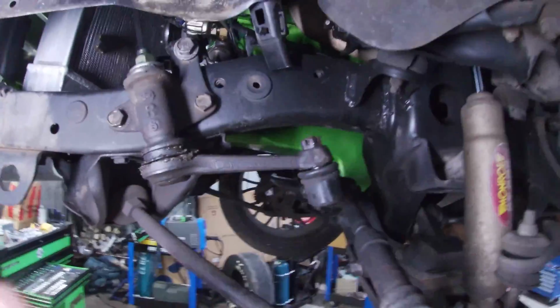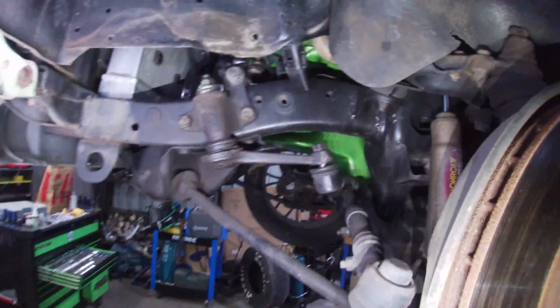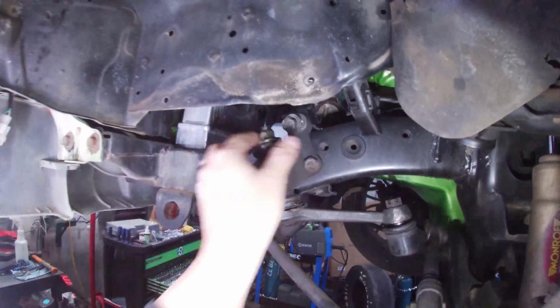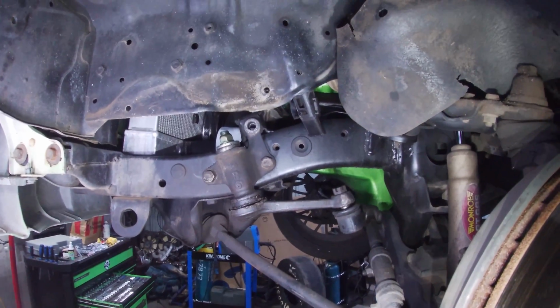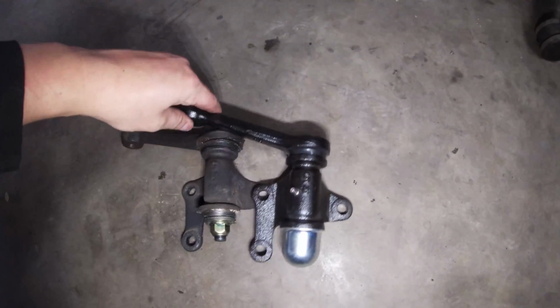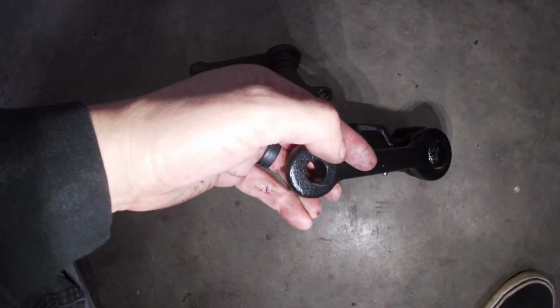Alright guys, I've broken that joint there, so it should all come off somewhat decently. Get a light on. Undone it off there. That'll drop down. I have cracked the bolts here. So they'll come out. There's a nut on the other side of those 2 bottom ones, so I'll undo those now and I'll show you guys once it's done. Alright guys, so we've got them both off. Matched them up, they both look pretty much identical once they're sitting there, so fingers crossed it should all bolt back in. The only thing I'm a little bit worried about is that it might be a bit flogged out on that ball joint. We'll have a look now and see how it goes.